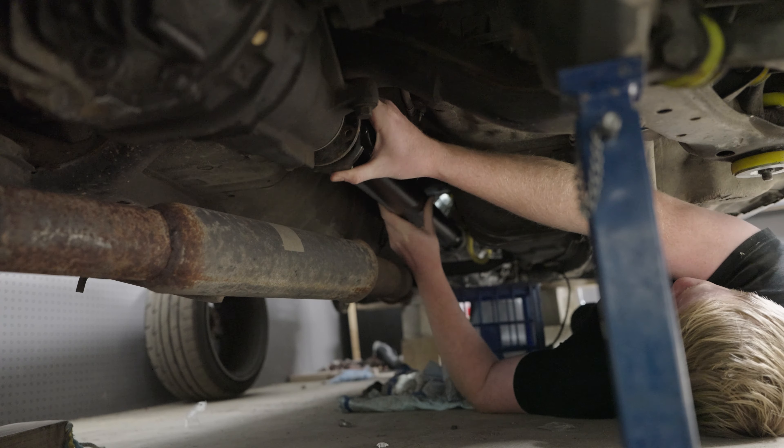All done. So it's all done now but I can't actually test it because I've still got to adjust the handbrake back here. There's this little spinny thing inside part of the rotor that pushes the pads out and it has to be almost touching. I did not do that when I installed the rotors and brakes and all that, so I've got to adjust that, then tighten it up, then test that it actually works like a handbrake should.